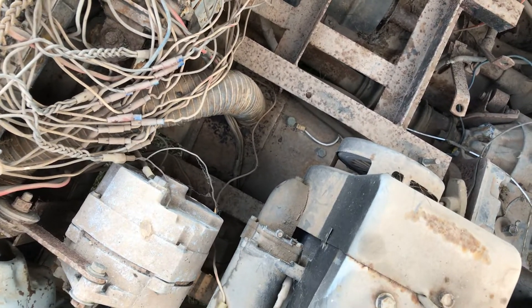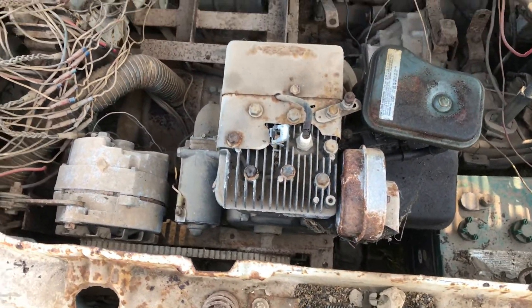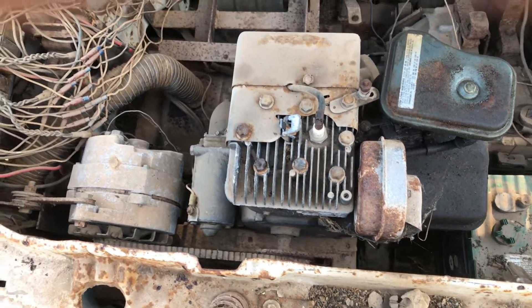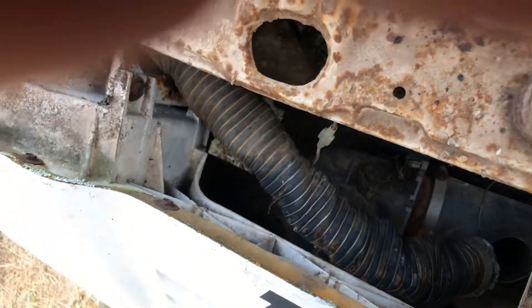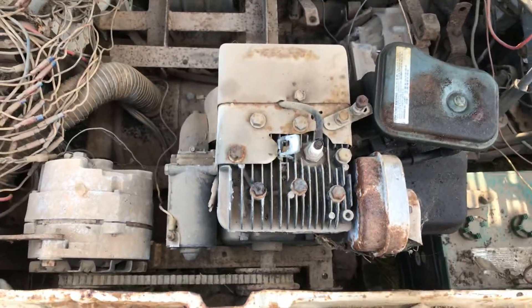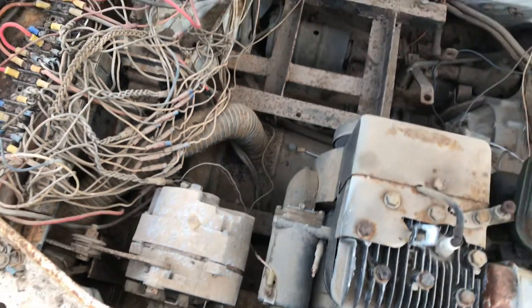So what were the additional switches up in the front for? The second toggle switch to start was because this vehicle is a hybrid. Interestingly, it has a gas engine — a Briggs and Stratton — up in the front that is electric start, and it has three alternators. What it does is basically you turn off one bank of batteries in the back, and while you're driving on one bank, this engine will simultaneously charge the other bank using these three alternators in order to extend your range.